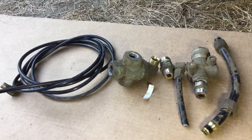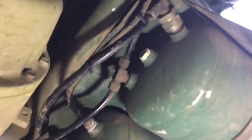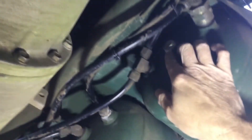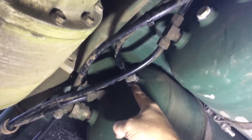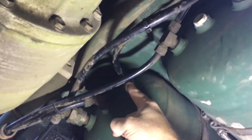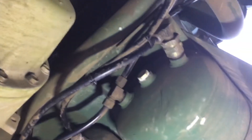There's another small pile of parts removed. The tank area up here is a lot cleaner now. I removed that valve from right here — the two-way check valve and the other remote control valve. Put a pipe plug in there, and I replaced this T-fitting with a straight fitting — half-inch national pipe to half-inch compression for the airlines. Things are routed up and zip-tied in place.